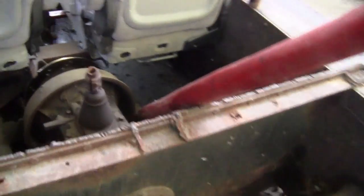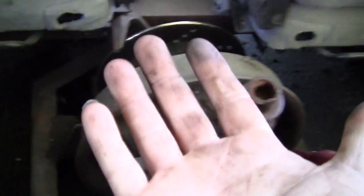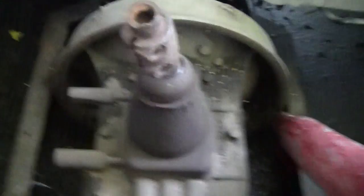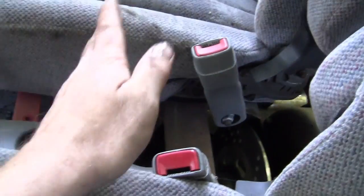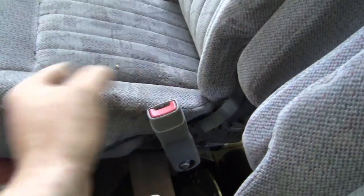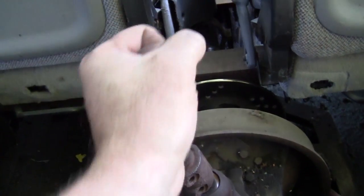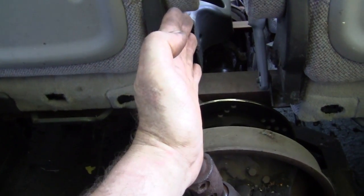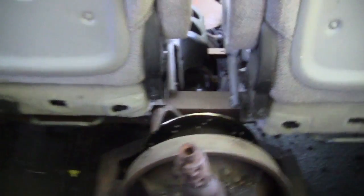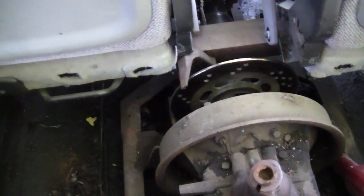This is what I gashed myself on last weekend — I'm gonna cut the top of this shifter off because it's quite sharp and it ended up giving me a gash that bled like hell. My plan is to put a shifter right through here with another shifter at the front so I can shift into different gears in the rear — into low or high — without having to jump out. That should give me a couple of pivot points: a pivot point here and a pivot point here, so it goes like this on a solid rod.